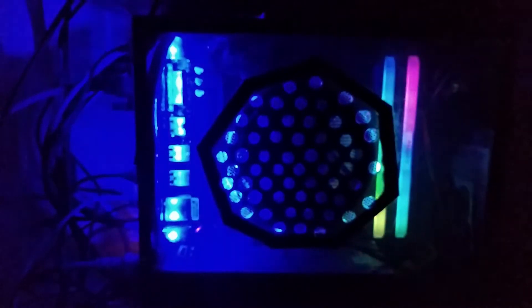I've been using the case as a stand for my monitor for almost a year and have never noticed any problems. The temps seem fine too. When gaming it gets a bit hot, around 80 to 85 degrees Celsius, but in regular use it doesn't go much higher than 50 degrees. When it heats up the fan spins faster making considerable noise, but as I usually use headphones it doesn't bother me.